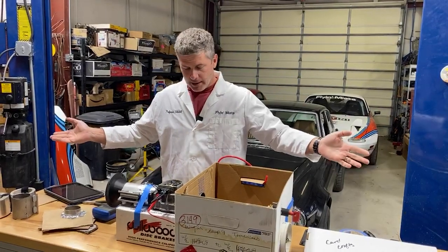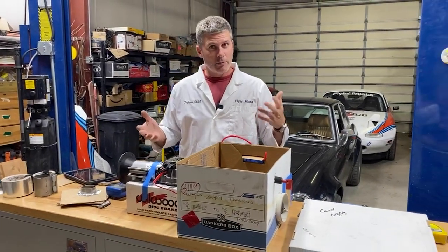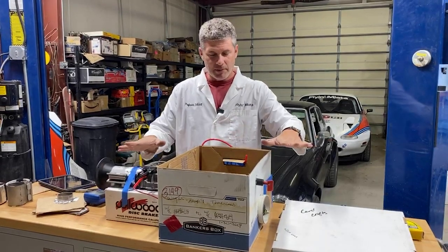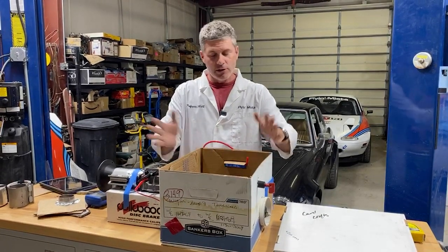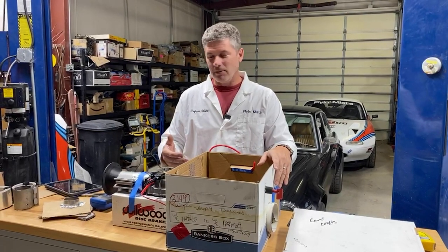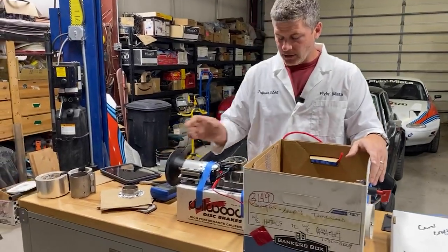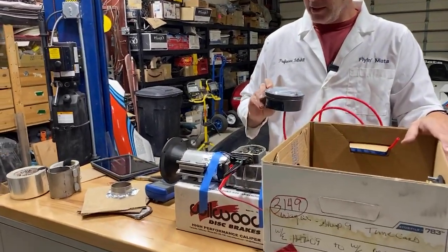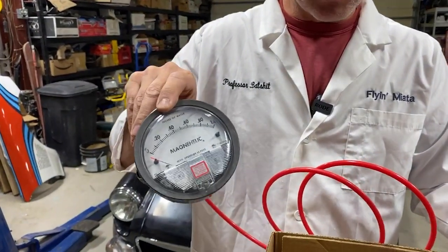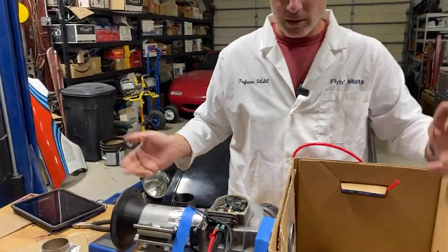So back to this thing. I did a little more research in the documentation and literature, and found out that this test setup obviously is not usually done with cardboard boxes, but is usually done with about 28 inches of vacuum. Now, I don't know how big the inlets are in that particular case. It could be jet engine size, but this thing is calibrated to one inch of water, and we're supposed to have 28. So I'm just not pulling any air through it. And you can feel it. When you get your hand against this thing, there's just no air going through.